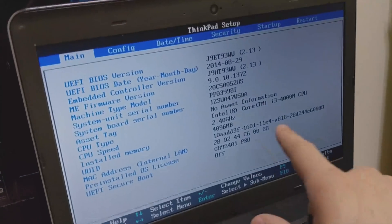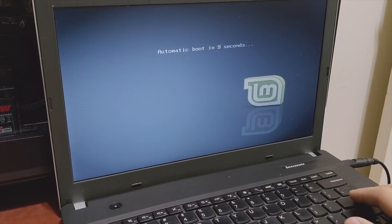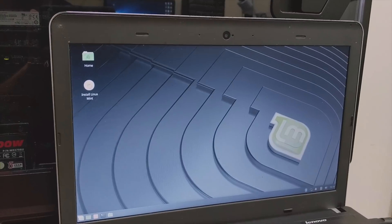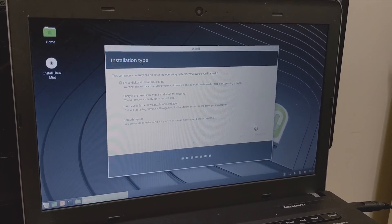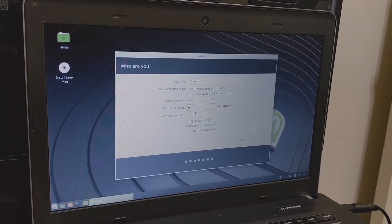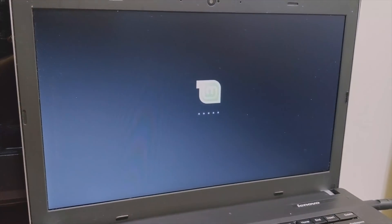Showing 4GB of RAM and the i3-4000M — exact same processor, same memory. Push F12 to get back to the boot options menu. We'll start Linux Mint, because this one you have to install through the live CD. To install Linux Mint, we double-click the install icon. Same process as before: select the language, keyboard, uncheck updates and third-party software, erase the disk, skip the region. This one we'll call Mint Test, password is spacebar, and log in automatically. Done installing — take out the install media and push Enter to reboot, allowing it to complete its first boot.